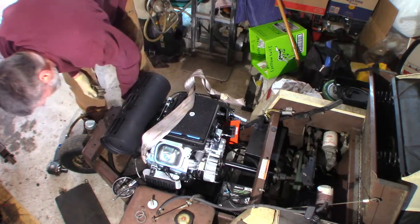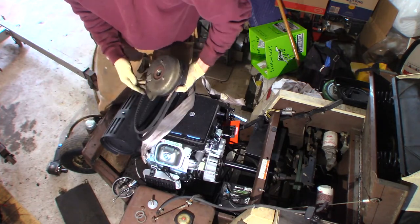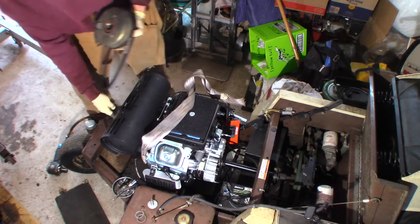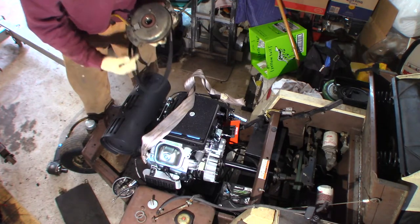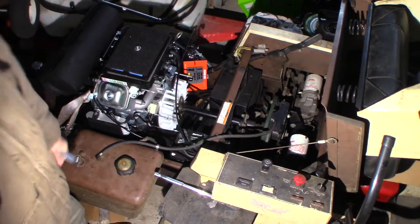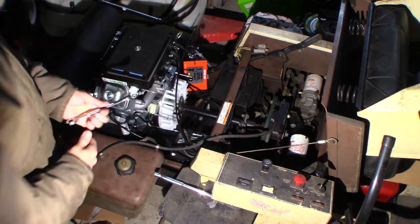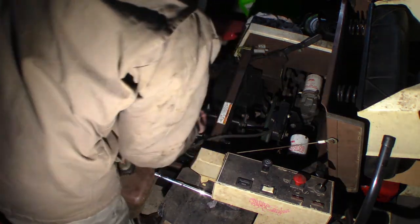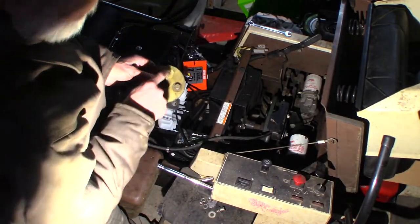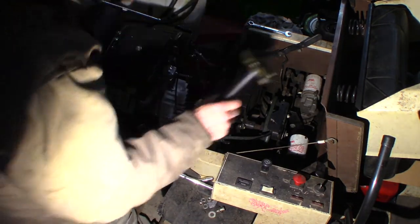Let me show you what I was talking about earlier. You see these notches right here — one here and one here. This has to point to this side. There's a bracket here pointing like that down there, and this has to sit in there so it holds everything in place. I've got an adapter I was able to get, but in order to get at this I've got to pull this drive shaft, which shouldn't be too hard. I need this as a template to do some measuring for the adapter.